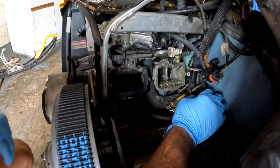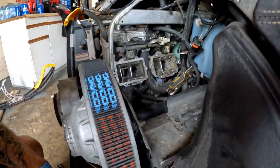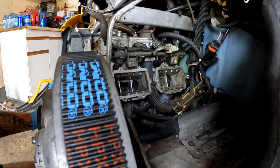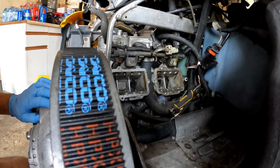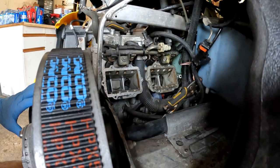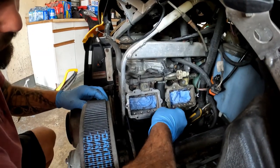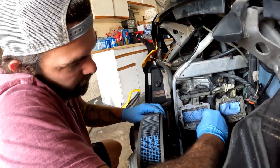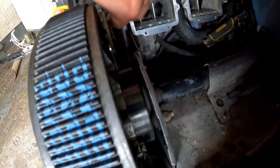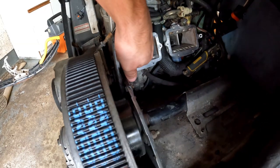Clean enough? Look at that — no chunks. That's a good sign. Give a spin over that clutch by hand. That looks clean, looks good. We'll just do a compression test. I almost want to use a wire wheel on this. Nice and clean now — use some sandpaper. If you guys do this, make sure you shove rags in and block the ports off, then vacuum out the holes before you pull the rags out so you don't get any grit from that sandpaper back in your engine.